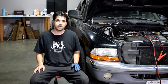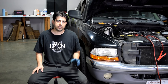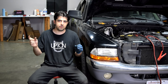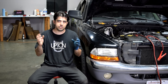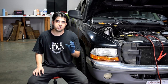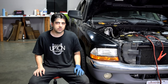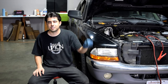Also by following this procedure, you can figure out whether you have a bad spark plug wire as well. If you're getting spark at the ignition coil and then you add the spark plug wire and test for spark at the end of the wire and you're not getting it, then the wire you just added is bad. But if you're diagnosing an intermittent misfire and you suspect the spark plug wire, there are other tests you should do — I'll put those in a separate video and link it on screen.